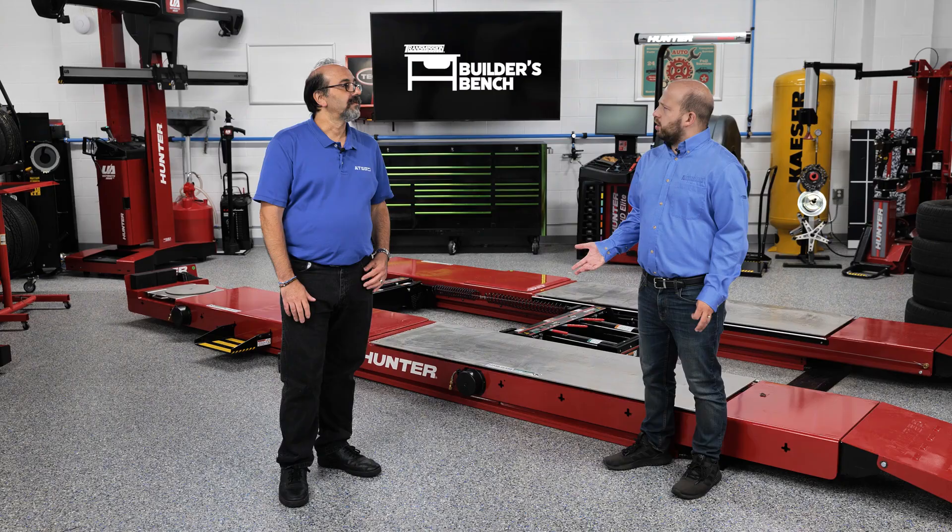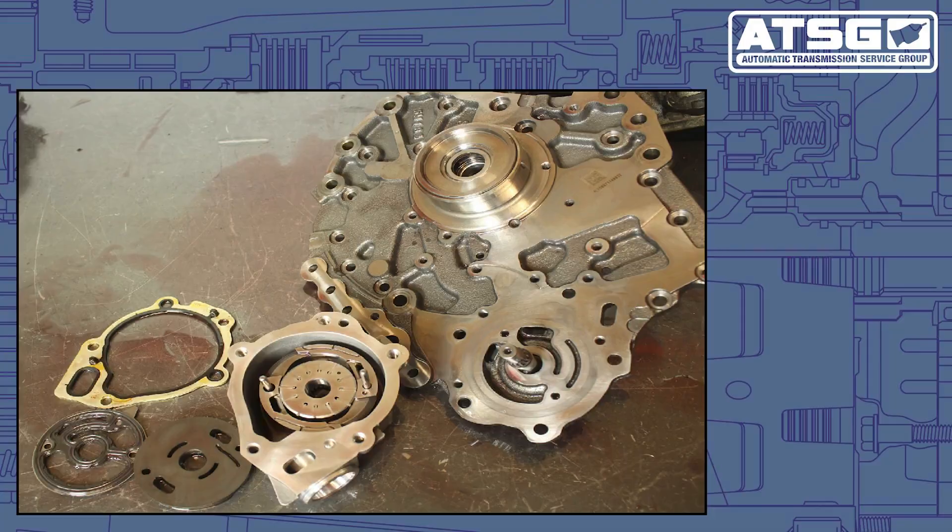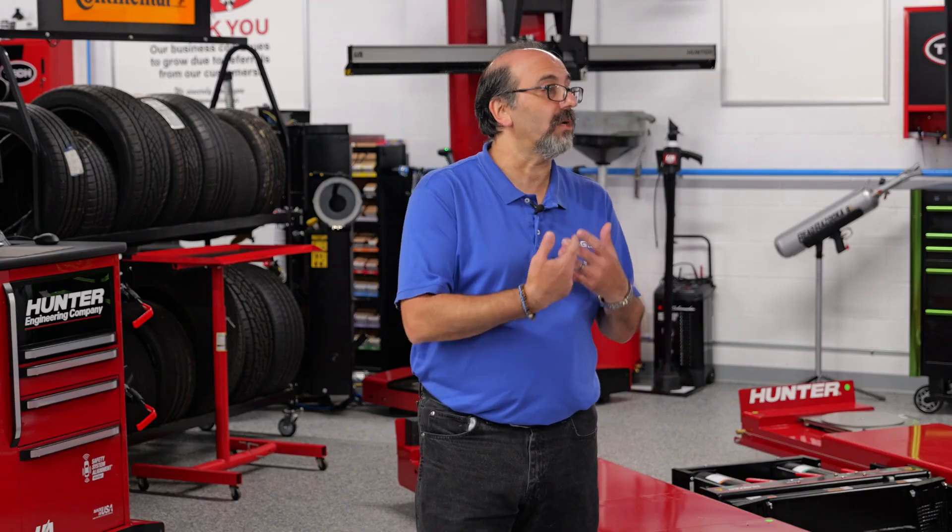Are there any issues that go along with this change to the pump? Yes. A shop might see one of these come in with very low mileage and have a problem moving forward and reverse due to low line pressure. That can be checked by putting a pressure gauge on the transmission. Low pressure has telltale signs when you take it apart. We've had many issues where the pressure regulator valve gets worn out and stuck in the open position, causing low line pressure. That is one problem, but sometimes we need to look deeper and actually take the pump completely apart.